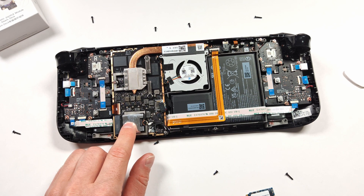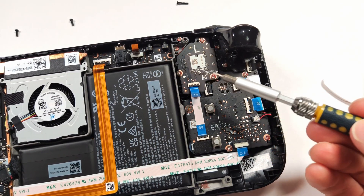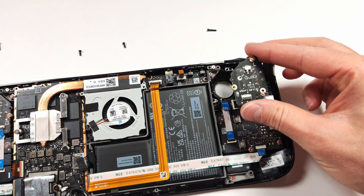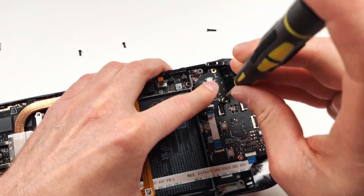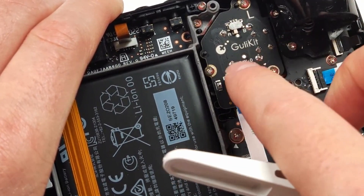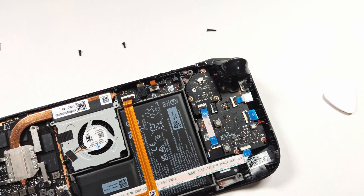The hard drive's in. Let's get those joysticks out next. Joysticks look to be pretty simple — there's only one ribbon cable here, and they even have little pull tabs on them. Then just go ahead and pull it out. There are three screws here that hold it in place — we've got to take those out before we can pull it out. That was the left one, so let's grab the left GullyKit joystick and drop that straight in there. Let's get those screws in next, then attach the ribbon cable. Make sure the lock is flipped up and put the ribbon cable in place. This is the switch — just make sure that you have it set to the correct model. That's Type A, which is what we need.